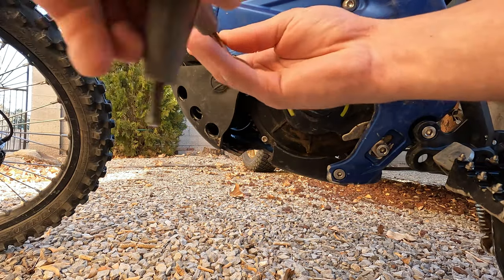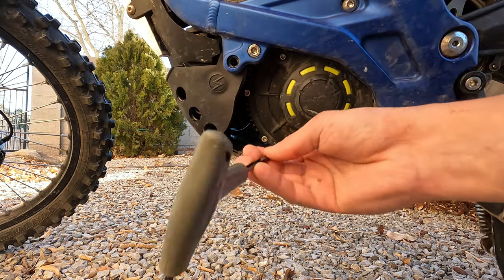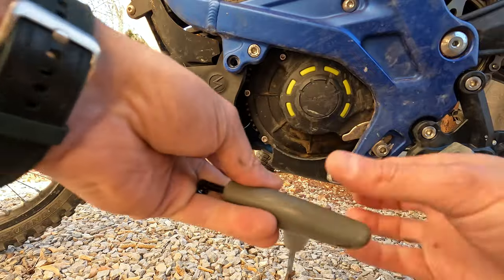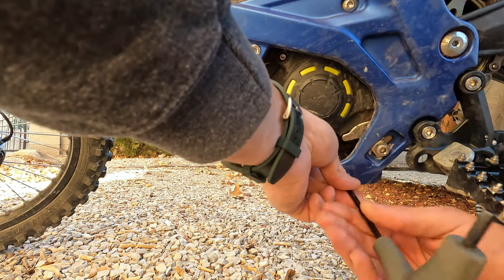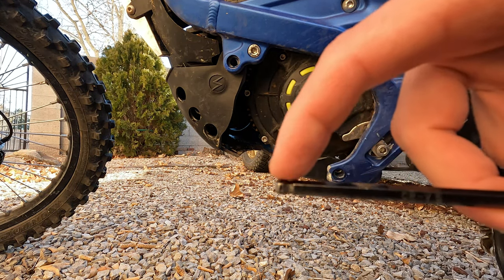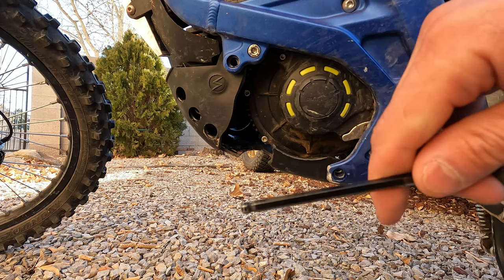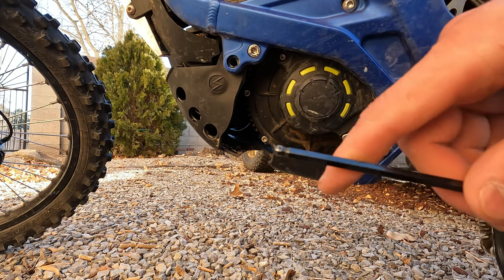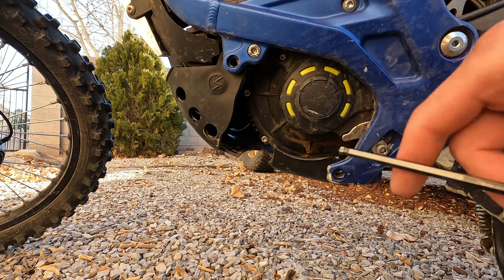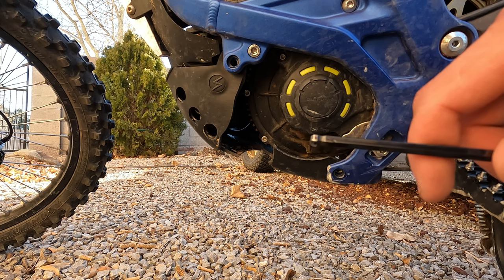Be careful not to confuse the skid plate bolt locations with the six millimeter motor mount bolts. I'm using these Harbor Freight ball-end allen keys. A lot of people complain about breaking the ball ends off inside bolts, but I haven't had that issue even under a lot of torque. The key is not to torque with the ball end — you always want to break the bolt loose with the straight end, then unscrew it with the ball end. The metal gets thinner around the ball so it'll snap easier if you torque with it.